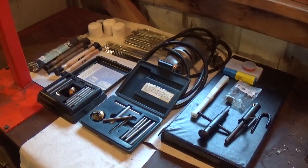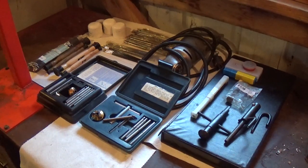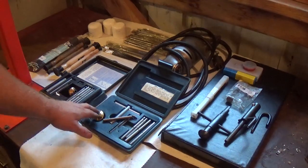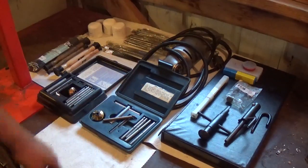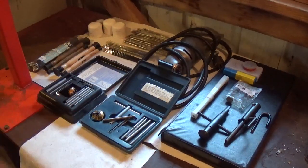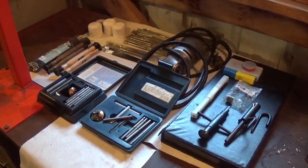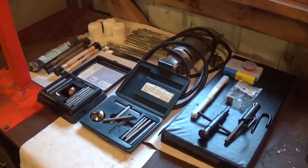Valve seat cutter equipment as well as my valve seat grinding equipment. They're highly similar in some ways, but there are of course differences. The major difference is the size of the pilots, and of course these are cutters and the valve seat grinder uses stones. But for right now, guys, let's just focus on the cutter so I can show my potential viewers that may not be aware of what this equipment is, how it's actually used.